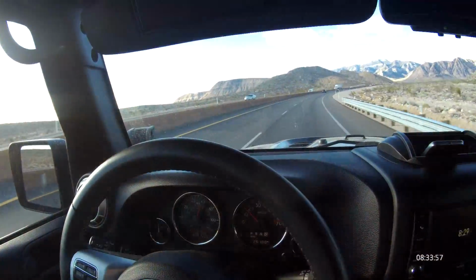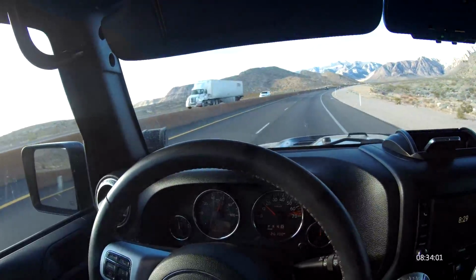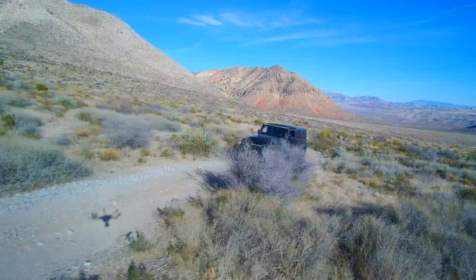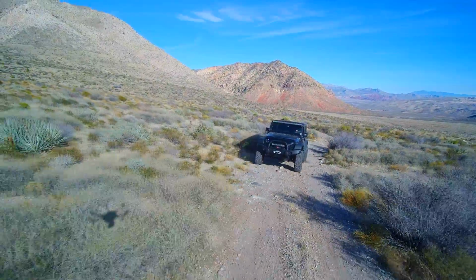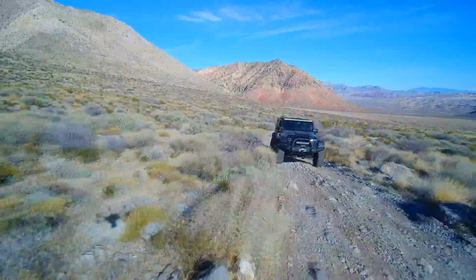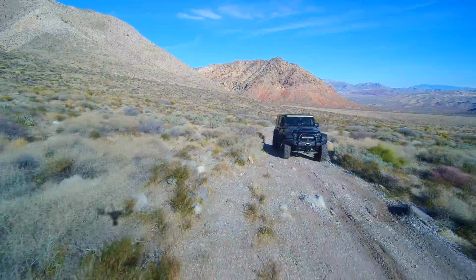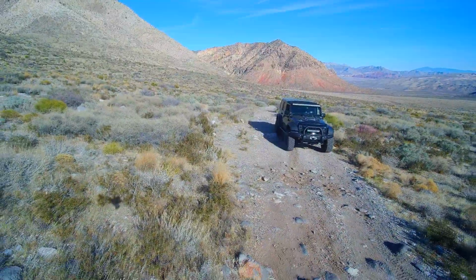And we did this for many years. I've got actually hundreds of vehicles out. They are running this setup. One advantage of this setup is the GM side is not dependent on the Chrysler side for its operation. So if the Chrysler side were to fail, let's say the TIPM were to go bad, the GM side would go into a standalone mode and operate.